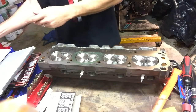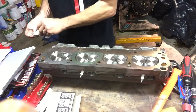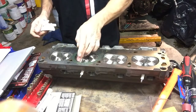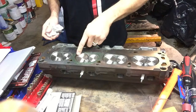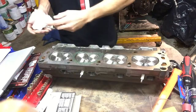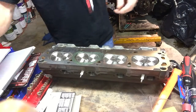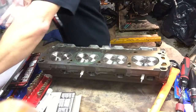So we've got some grease around it now. I've cut a piece of plexiglass plate that fits over this. I think mine's about 5 inches square. It doesn't matter, as long as it covers it in its entirety. Also, I'm clearing any grease out that got too close to the edge here. I don't want it to affect my CC readings. So here's our plate. Wipe it off.